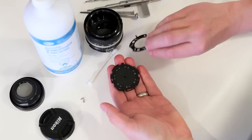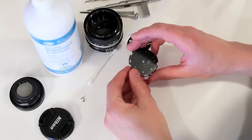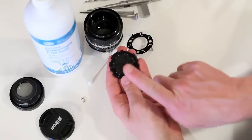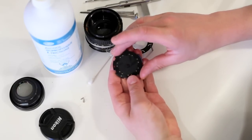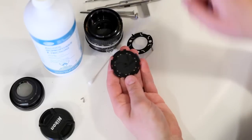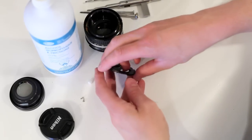All nice and oily. This one was actually still working but it was hanging up just a touch - it's starting to leak. When you're putting the aperture back together, you're going to want to remember the aperture blades point clockwise on this particular aperture. They're all pointing to the right - the blades, the points. Just knock them out.